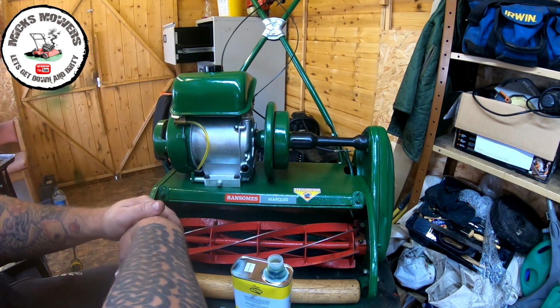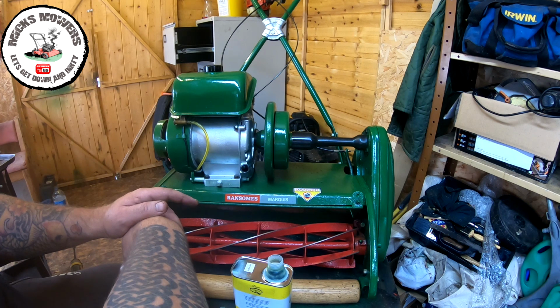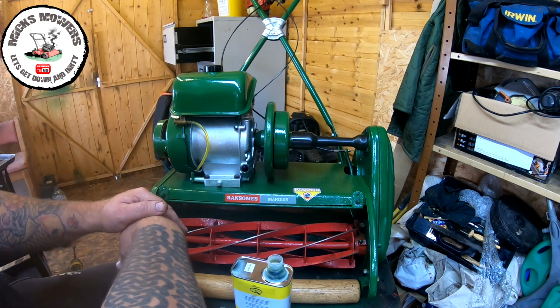I'll come back once I've got it to the correct level where I think it should be, and then I'll pull it over a few times. I don't want it to start, so I'll take the HT lead off, just pull it over, and then check the level again. I think I'm nearly there. I've got my little tiny torch here. I'll come right in, and you can see pretty much I'm right at the bottom of the threads